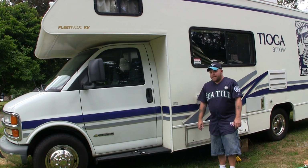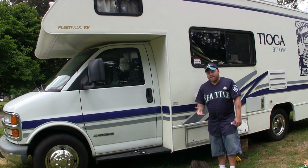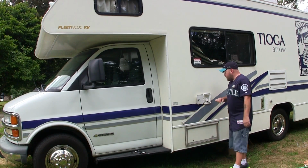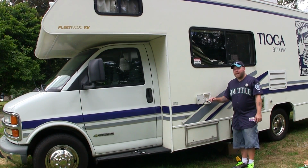The safest way to do it is just to turn the water pump back on and empty the tank manually into the sinks or the tub. Okay, and then once you've got all of the water out of this empty, the water pump cannot pump any more water. We're going to fill this up completely, 42 gallons, and we're going to repeat this process until we no longer smell bleach coming out of the faucets on hand.